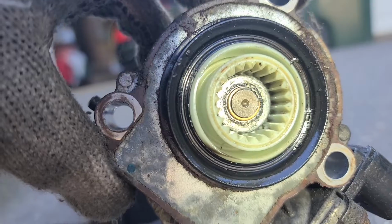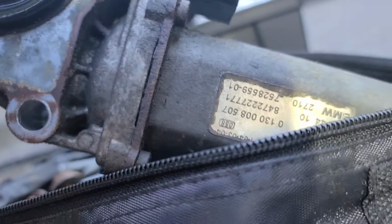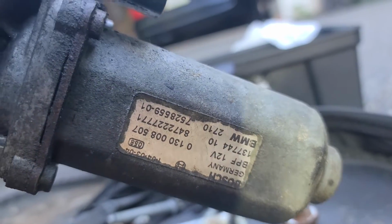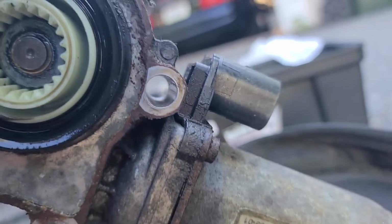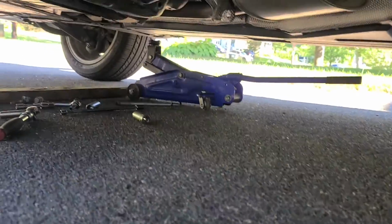There's a switch which is a servo motor, which is right there. I see that's with the cable on there. I'm gonna show you what it looks like. Mostly that's what's going bad. That's this motor right here. Usually in here there's a gear that's underneath this that goes bad. And that's the part number. This application is used in some 6-cylinder engines or some of the V8 engines as well. It's pretty common, so I wanted to make a video about that.